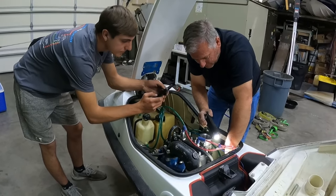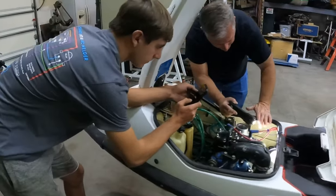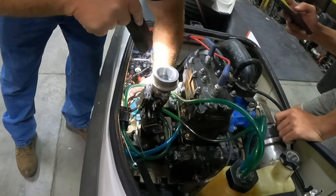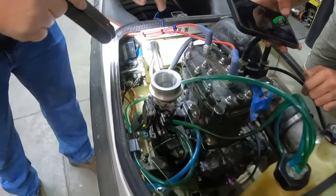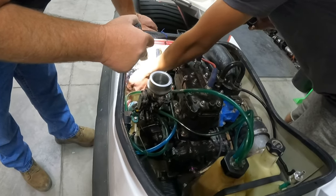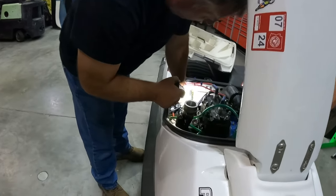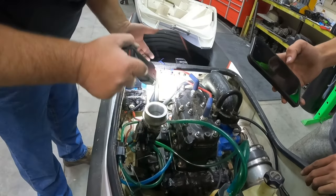So when you take these four bolts of this black cover off, what you're gonna do is take these two bolts out, the CDI lays down, and then there's two bolts behind it for the blue box, and there's one bolt down here in the center. See my finger down there? Under there, you can reach under there and feel that single bolt. That single bolt, and that whole box will come out, and you can lift that box up and set it up here. When you take the four bolts off, one, two, three, four, that separates.